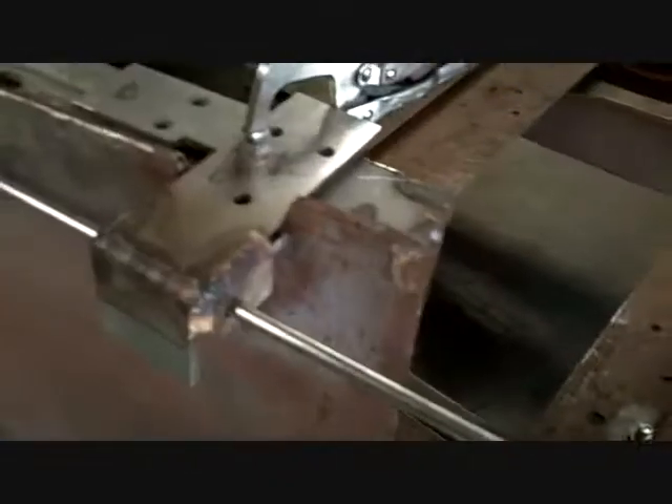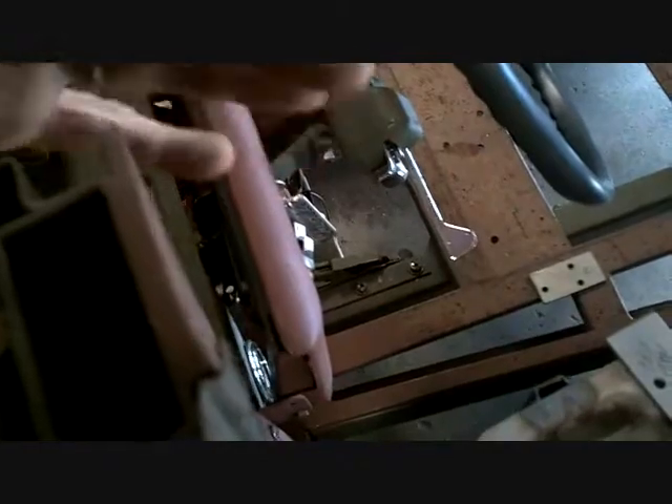Making hinges is a lot of work. You gotta pay attention to where it's gonna swing, what it's gonna hit, what it's not gonna hit, is it gonna clear — they don't just fall into place. I have to think, does this have to be a little high to meet this? No, cause I remember when it was on the body there was a big gap there anyway. This plate is flush with the whole dashboard, but the wood gave it a lot of play, so the hinges didn't sit flat — they actually spread apart like that, cause the body isn't square. The body bows out as it goes towards the back.